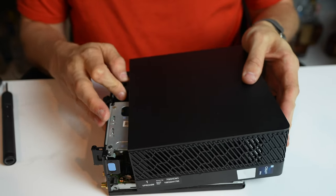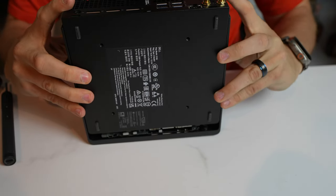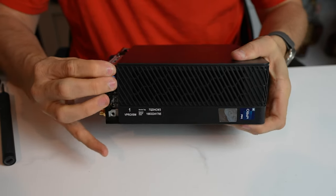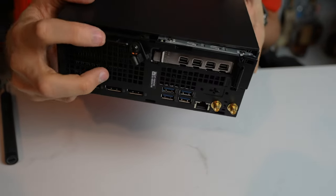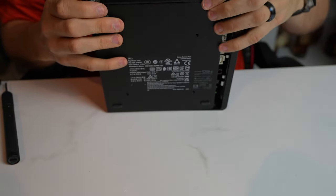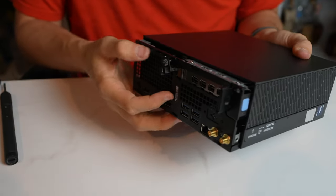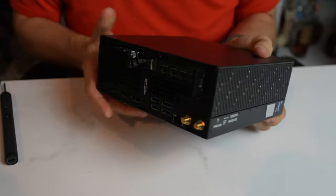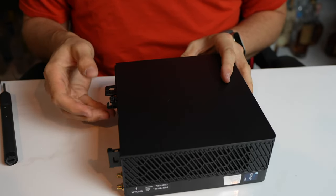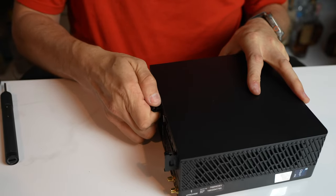They are a little particular. So once you get it started here, what I like to do is set it flat here and make sure that these are all flush and everything. And these should pop straight back in here. Again, it is a little finicky, so you have to watch this. Another thing to keep in mind is this goes through this back piece. It doesn't go on top, and it comes with a side panel there. So once we get this bottom channel in, which is wanting to fight me a little bit, you also have to watch the PCI bracket because it is bad about trying to come out. This piece has to stay clipped back here, and it slides right on. And then to finish everything up, we're just going to take the little cable management piece here and then screw in the back thumb screw, and we are fully reassembled.